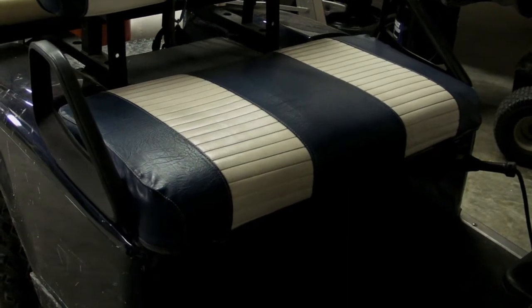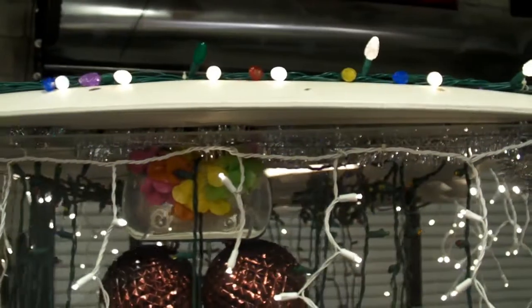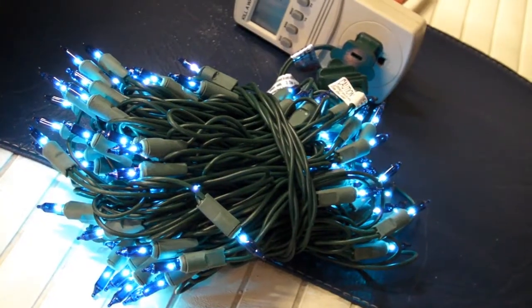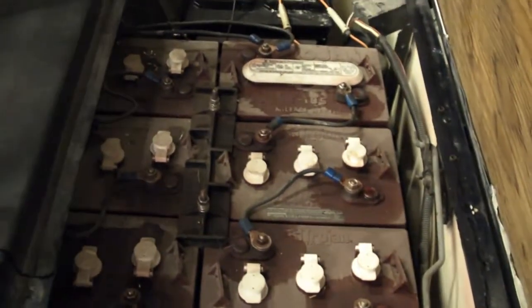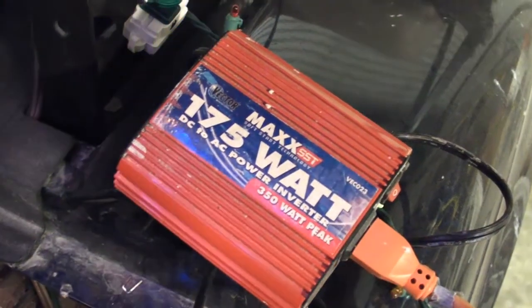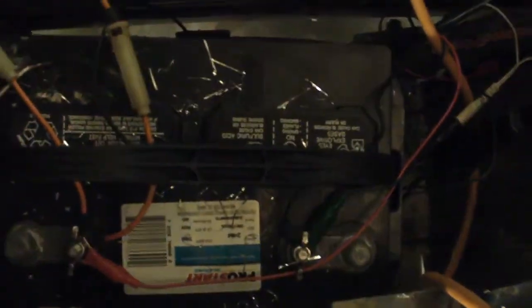The first requirement was everything must be portable and run under battery power, since this is an electric golf cart. Most importantly, the lights must be low power, so LED Christmas lights fit the bill quite well here. A string of LED lights draws an amazing 2-4 watts of power compared to their incandescent counterparts' 30-80 watts. Rather than using my existing golf cart batteries, I added an additional 12-volt marine deep cycle battery. I used a small inverter so I can use standard off-the-shelf 120-volt AC strings of LED Christmas lights without modification.